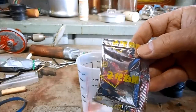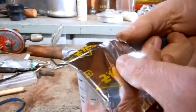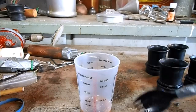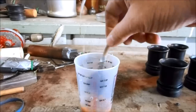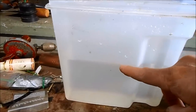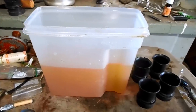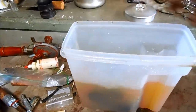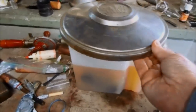For the base of the plasticizers, I use the genuine Mikuni stuff. With everything in the mixing container, I blend it together using some denatured alcohol. One liter of water in my soaking container — I add my concentrate and blend it thoroughly. With the solution complete, you can just drop the rubber in and let it soak for 24 hours. Make sure to put a lid on it so the solution doesn't evaporate.